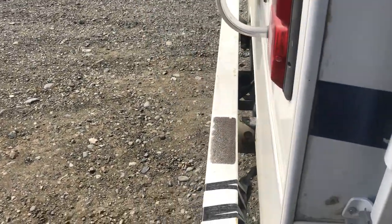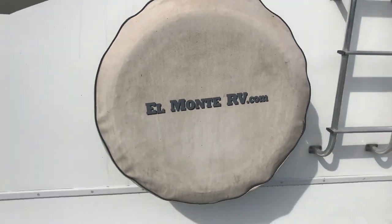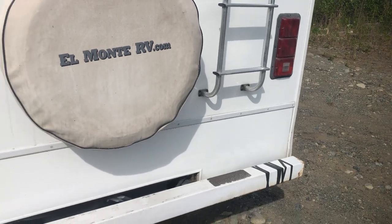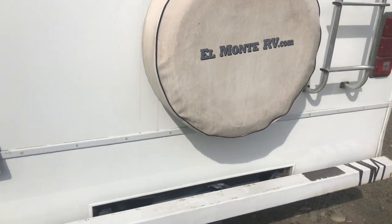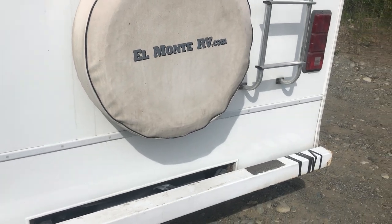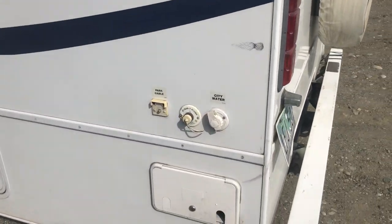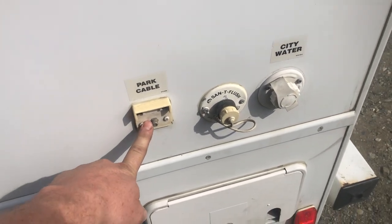You have your spare tire. These do have a ladder, but unless it's an emergency, please don't use it. The roofs are just a thin rubber membrane, and if there's a rock in your shoe it'll leave holes in it, which causes leaks. The membrane replacement is about five to eight thousand dollars, so avoid going on the roof at all times unless it's an emergency.